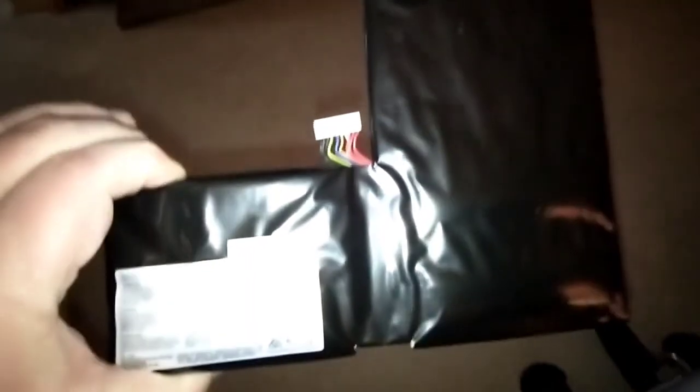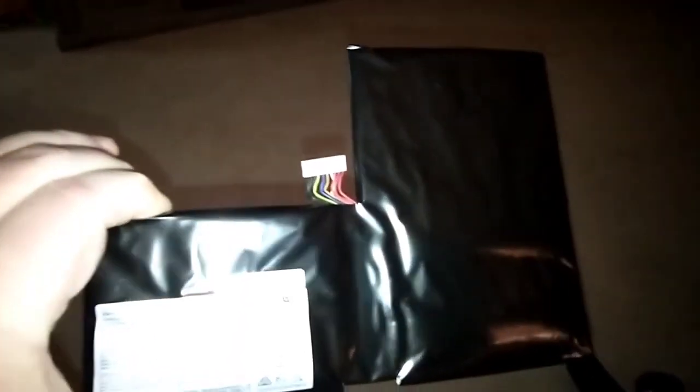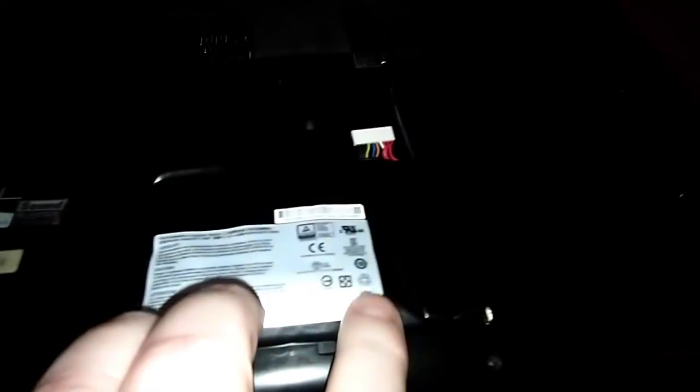There's 3 sections, about 3 inches long. There's a section here, square. There's a section up here shaped like an L. So let me show you over here, background. There you go. It's shaped like a backwards L in there. It's in this plastic wrap. It can bend right there a little bit. But see how it's starting to swell up? Let's see if it's showing up on camera there. It's not flat. See how that's all swelled up from the side angle? Once it starts to swell up like that, you've got to replace it. It becomes flat when it's new. This one's really swelled up right here.